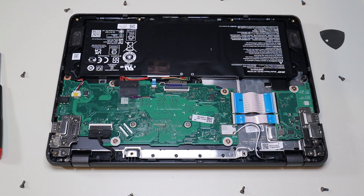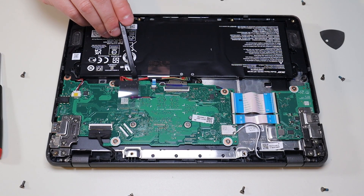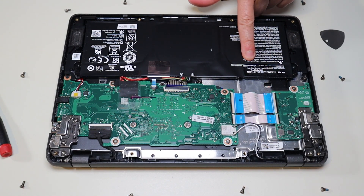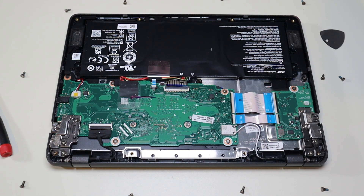Now before touching anything in a computer, I always remove or at least unplug my battery. A battery is safest to work on when as little power as possible is running through it. Your battery is right down here along the bottom of your computer, and there are no screws holding it down so it's very easy to unplug — it plugs into the motherboard right here. This battery has model number AP18C8K, it's an 11.25 volt, 50.29 watt hour battery. I'll have all that information below in the description and included in the replacement parts link.